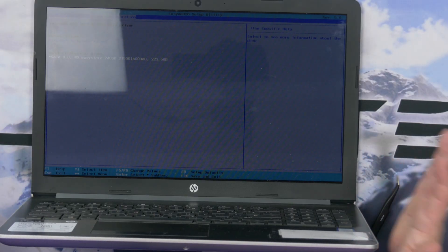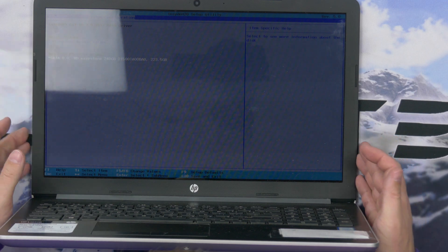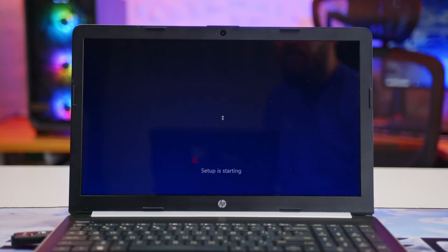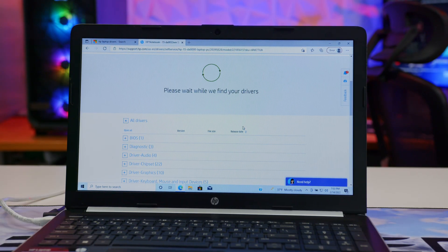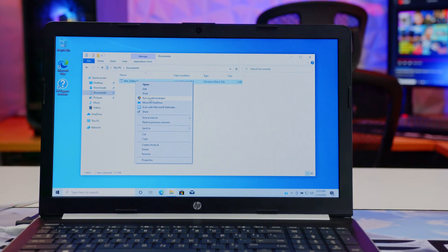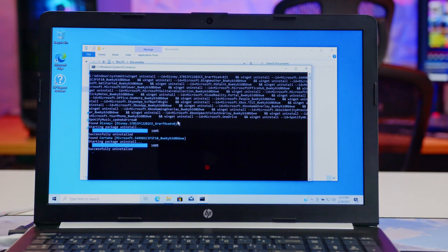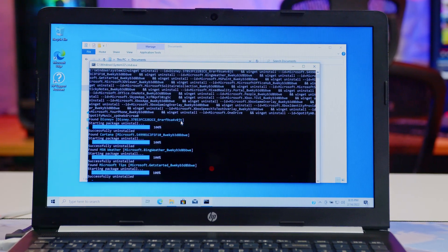The system did boot into BIOS and the new SATA EasyStore 240GB drive is recognized. Unlike previous laptop refurbs or repairs I've done, I can't clone the original hard drive because it's dead. So I'll be doing a fresh install of Windows 10 and installing all the drivers. If you want a step-by-step guide, you can check out the video linked here or in the description below. I'm also going to use a Winget script to remove all the bloatware that comes with a Windows install — I have a full tutorial on Winget linked here, and I'll be uploading this script with instructions for my Patreon members.